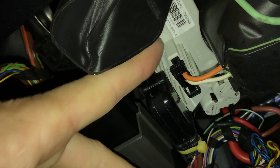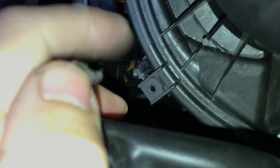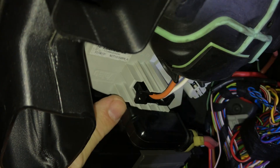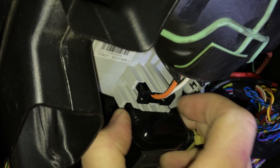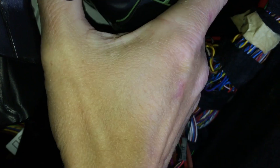This white thing here is the heater resistor, and then the motor itself is this unit here. It should have a little screw in there but it's missing. This went into the dealers for a modification on this heater motor not long ago — makes me wonder if they took that out. Put the screw back in, there's a little tab in there, push that in on both sides, and we should be able to just twist, rotate, and pull it out.